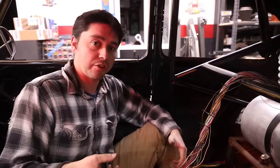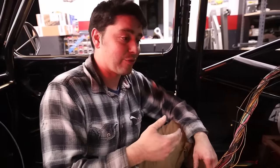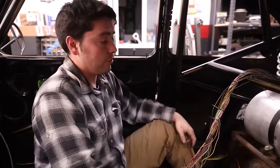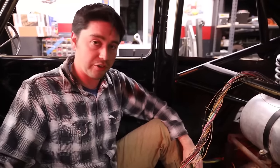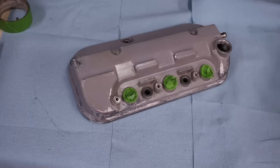It just falls apart. Like you said earlier, this thing wasn't starting half the time. You push the button and... Because I found out it wasn't even connected. They used a butt connector on this and it was not even connected. They crimped the plastic, not the metal. So that's why it was in there. Yeah, it was working only half the time, or not even. So I made it so that it's always going to work all the time. Yeah, perfect, dude. Hell yeah, thank you. This looks awesome.